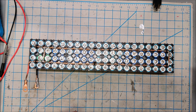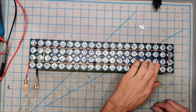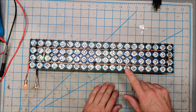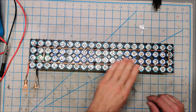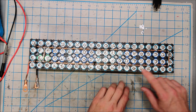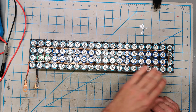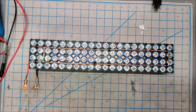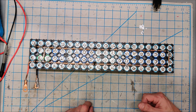I have reflowed most of the bus bar connections. They definitely look better. Touched up a few of the solder joints — not my best solders I've ever done, but I've re-beeped the pack and everything seems to be connected. So I'm going to throw a charger on, bring it up to 4.13 to match the other batteries, and then I'll throw it back into service.